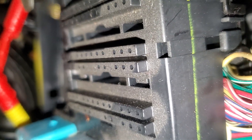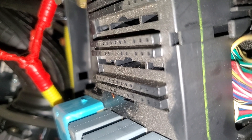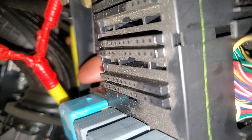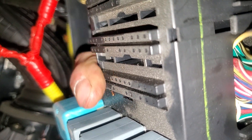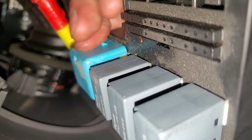They're going to be up in here. There's a total of four relays. The one closest is going to be the heater relay. Immediately behind the heater relay is the power point relay. The one behind that is the tail light relay. And the final relay in this location is going to be the inverter relay — this is the inverter relay right here.